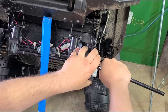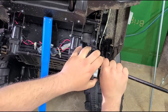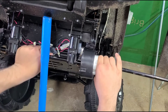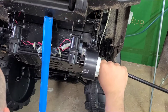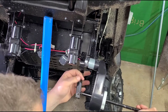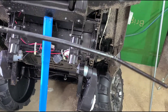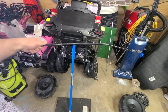So what we're going to do — the axle size is actually seven-sixteenths. Half inch is going to be too big; it won't fit through these gearboxes. So seven-sixteenths — you can get a three-foot length and then you're going to have to cut it to size. If your ride is bowing or anything like that, you should really replace these, because yeah, he hit this up pretty good — you can see it's a pretty good hit.